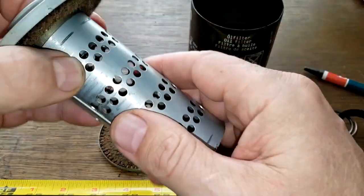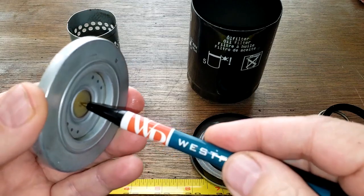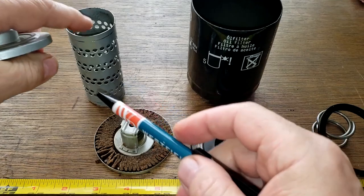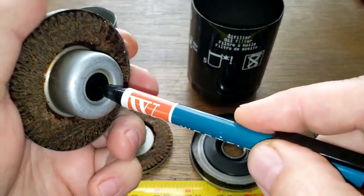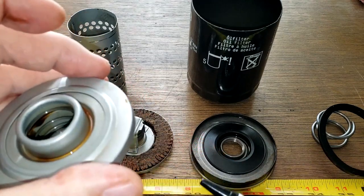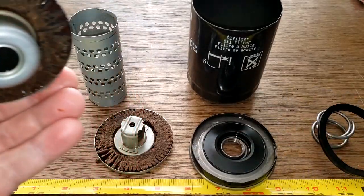The core is pretty cool. You've got these holes that are all nice and smooth. You've got the bypass valve down here — pretty hard to push. Then when your oil goes through the filter media, it goes through these holes and up here — it's got to go through this one but this one goes nice and easy. That's how your oil comes out. Why they have this I don't know — most filters just have a straight hole and it comes right out. You can see the spring in there. Strange design.